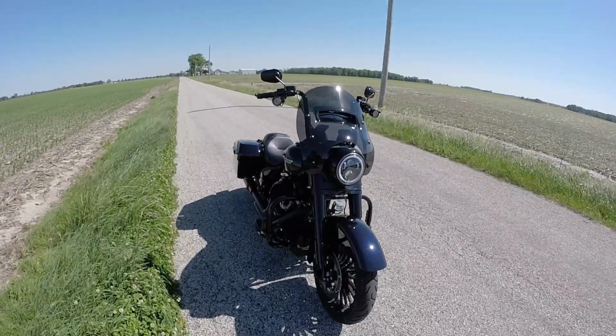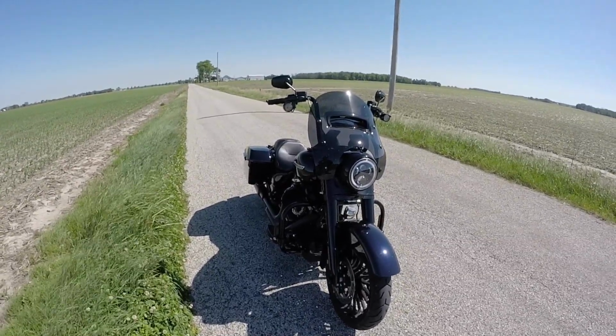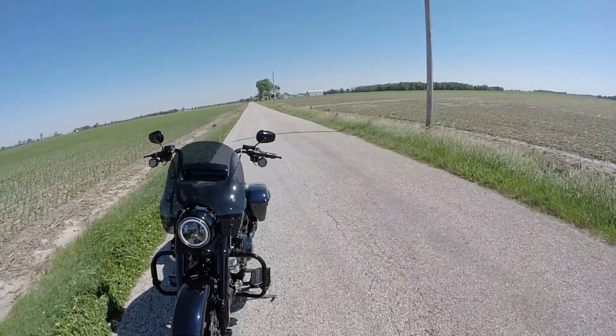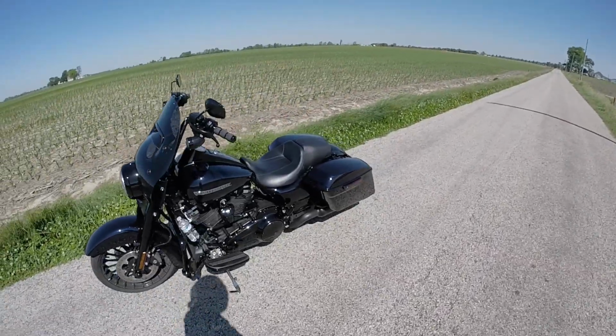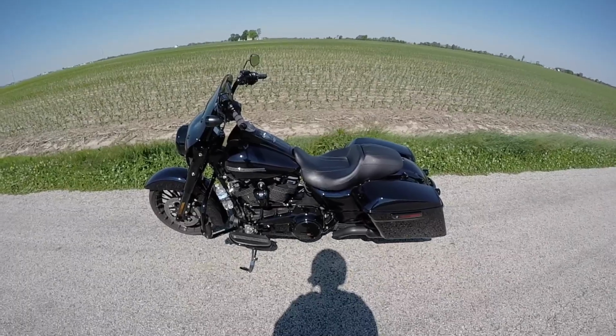So for the fuel tables, the Lambda tables, I have my Lambda tables set around 13.8, and then cruising speeds are around 14.1. It performs very well for what I need.